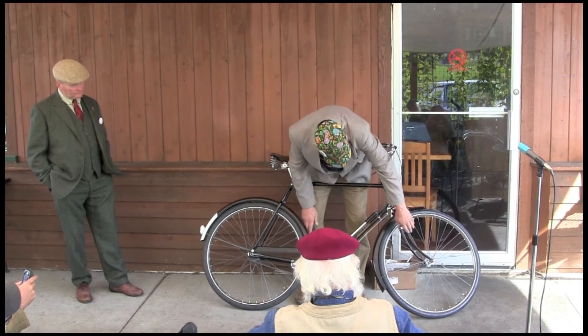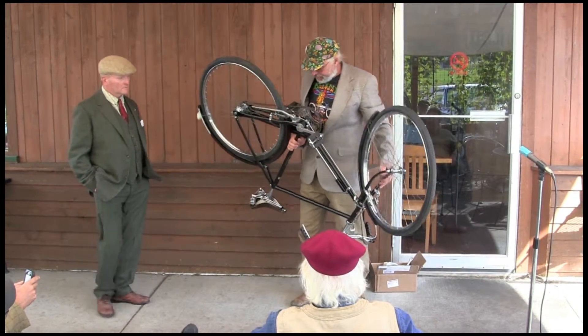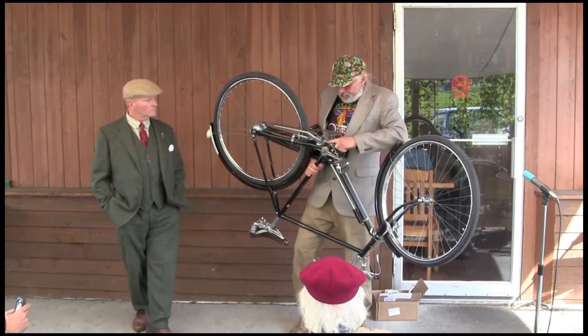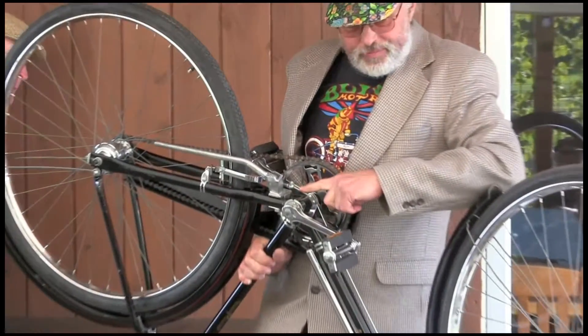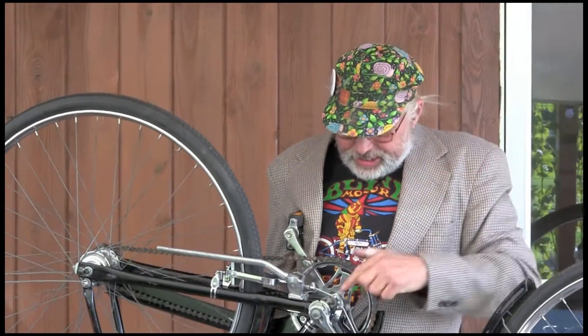Here's a fun thing — another faux pas that I just love to see because I know how easy it is to fix — is to clear this kickstand, they bent this rod. Now anytime you are applying your strength to stop your bike, it's got to straighten that rod out a little bit.